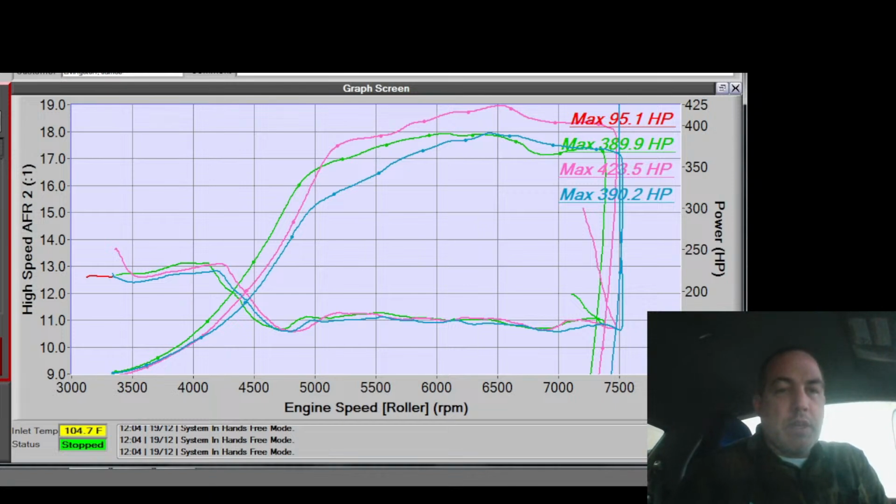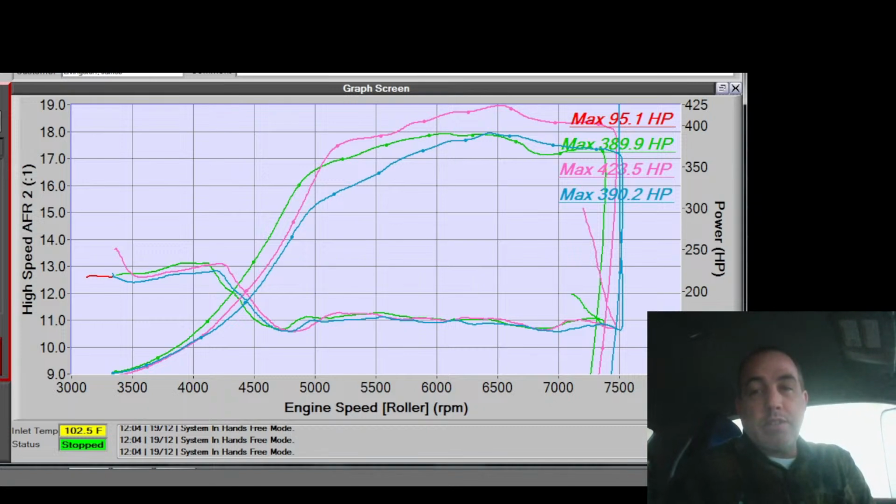Let me look at my knock settings, see if they're factory for my knock sensitivity. It might still be factory. I probably didn't even change them. Oh yeah, that's all stock. Yep, and it's really, really sensitive right at 4K where this keeps happening. Wow, that's that low? 3.1? I don't remember the 04 STI being that sensitive, Jason, do you? 3.1 at 4K? Jesus, most of these cars were like 3.2 to 3.7 across the board on this thing. And this thing is at 3.1 with forged pistons, so okay, I need to bump that up a smidge, especially in that region right there. Okay, that's going to make a big difference. That's going to make way more sense. 3.1. Okay, sure. Good.